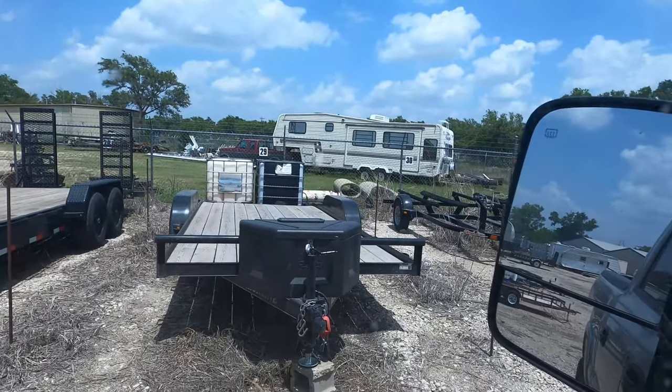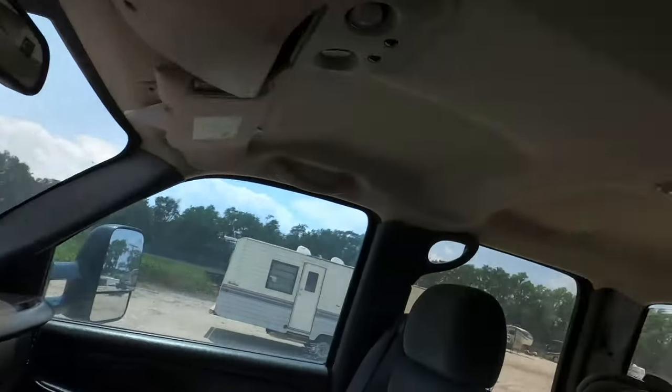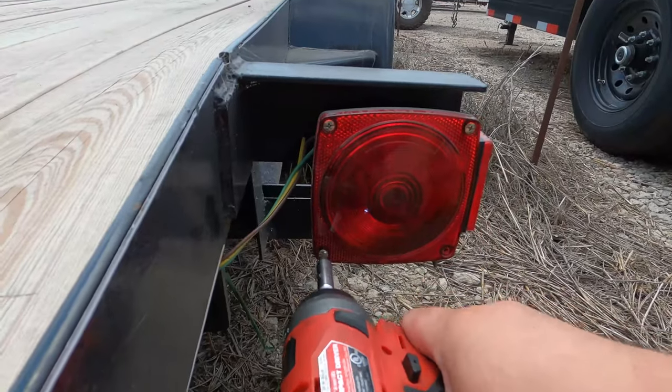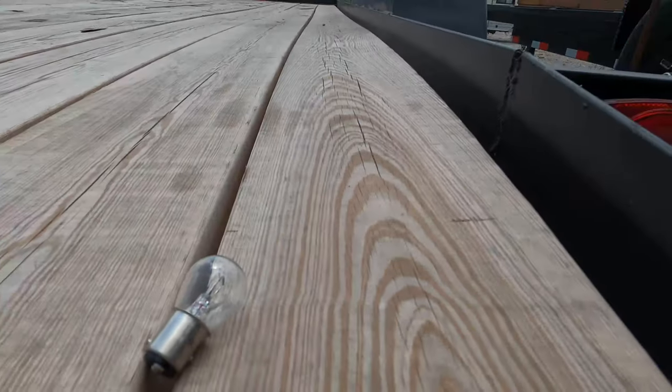There's the turd right there. We're going to need one bulb. These Ico 10-packs are fantastic — one new 1157. We're going to recycle the 1156 I pull out of it, because it's brand new as well. We've got four screws in the corners, they're all Phillips. That plastic fascia filters the light and turns it red.